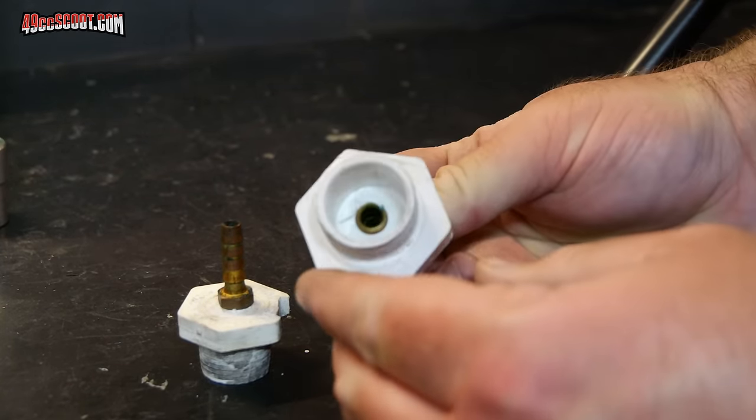5 to 7 PSI is what most of us will be working with — that's what you want to pump it up to. So you'll start pumping and hopefully you'll see this gauge go up, then stop when you get to your target. I'm pumping it up now, you can see my gauge starts rising — but I can already see I've got a problem because my gauge is falling. What we're hoping to see is that when I stop pumping, the gauge needle stays still. But you can see the gauge needle is falling down quite quickly, telling me I have a large leak somewhere.